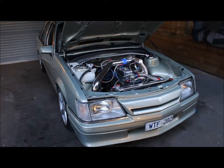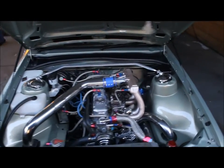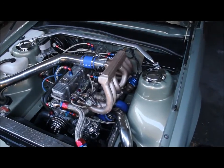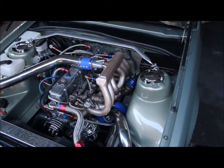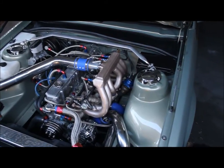It's pretty much the same as the last build inside. We've got the Gasket Solutions MLS head gasket on it. Hanging off the side we've got the standard VK EFI inlet manifold ported out a bit, and we've got the Garrett GT35 Turbo with a 0.82 exhaust housing on it. Squid Tech manifolds as we had before, and a Tial wastegate there.